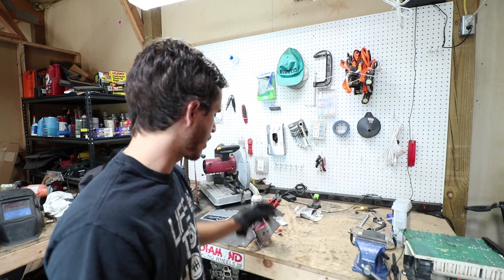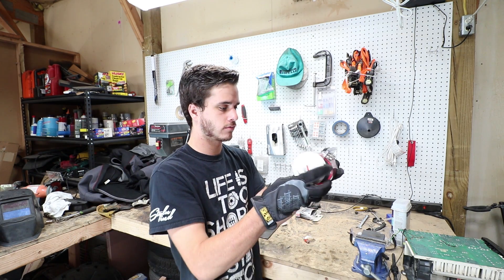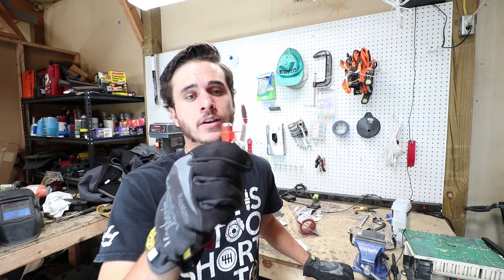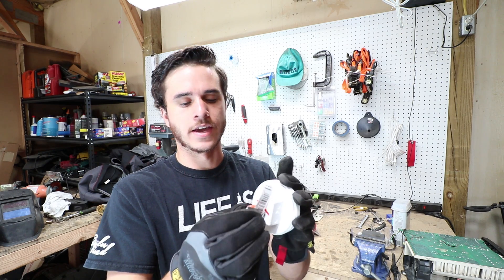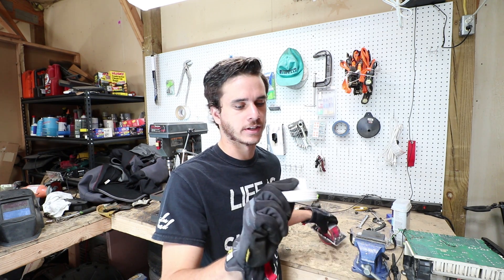Alright, we're back at the shop. Here is how this process is going to work: this fitting is going to get clamped inside of this coupler — hopefully it fits. This is going to get threaded into this piece of PVC, so I need to drill a hole for it and seal it all up. The other end of this coupler is going to get clamped onto the turbo inlet on the car. I'll put about 15 pounds of pressure in using my air compressor so I can hear that horrible noise and track down where it's coming from.